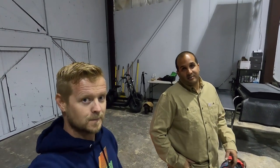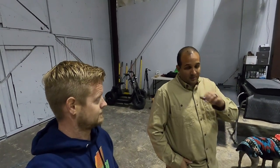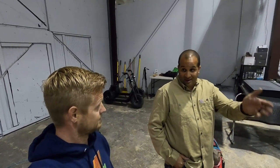We did have someone comment just today on that video that went out. I guess he was doing his paint prep, and you know who you are, but it was something about his orange peel. He was trying to address that. How do you address orange peel? We read his mind in the video, about hitting it with the 60, the 120, how to get that knocked down. The soft pads really make a huge difference. Just gotta be careful on your flat areas, the edges, the corners. Make sure you're not getting those real hard.